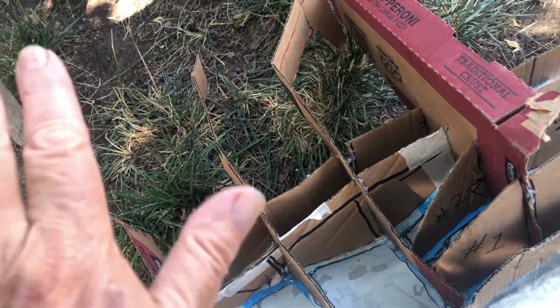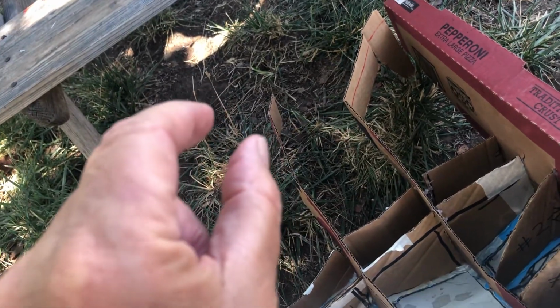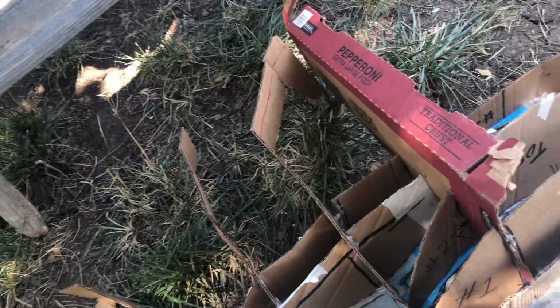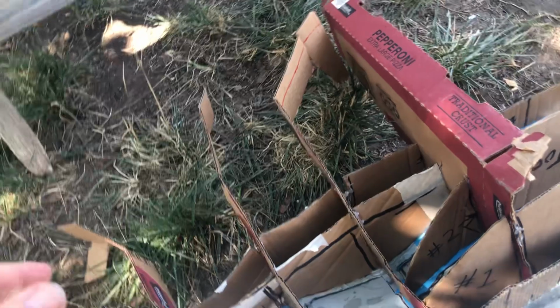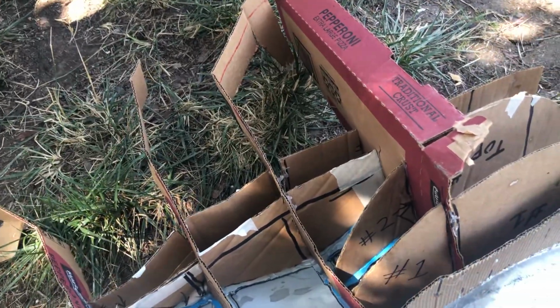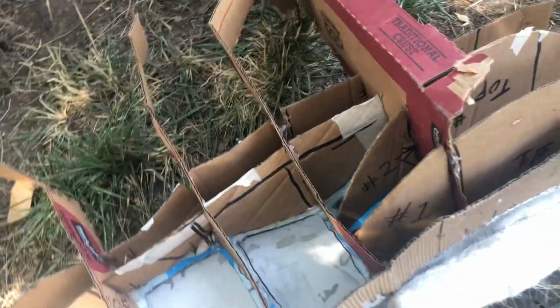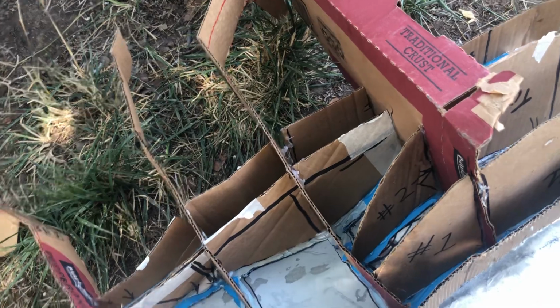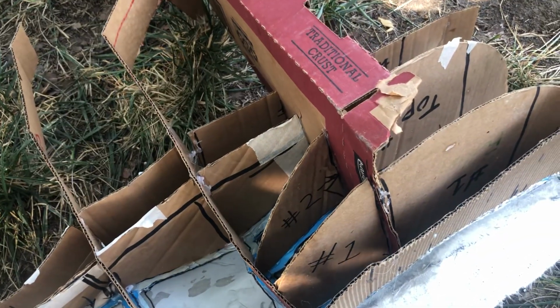And anything that's angled, let's say it's a 45-degree angle, and the insulation is a half inch wide, well, that's going to be in the wrong direction when you flip it to the other side. So you're going to have to do a lot of modifying to get it right if you use that approach. Using the foam board, it's really thin, and you won't have that issue. Ideally, obviously, you want a point contact, but that's not feasible. So foam board would work really well.